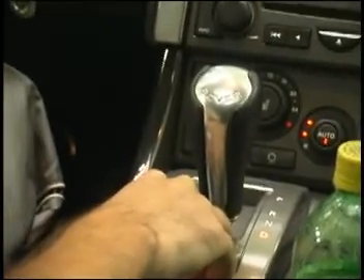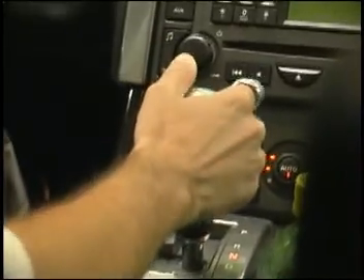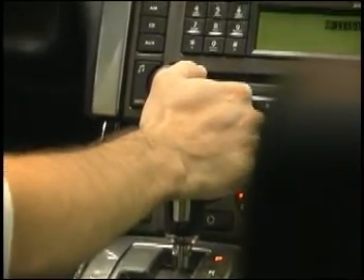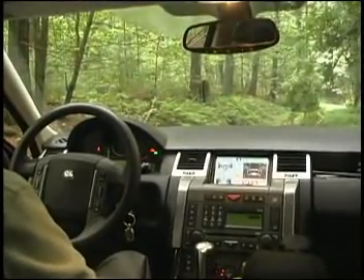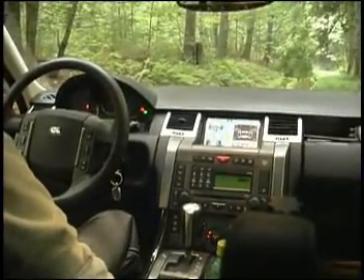Apply the parking brake, then transmission to neutral. Gently release the foot brake. Then back on the foot brake, and then into park. What this does is put the weight of the vehicle on the parking brake and not the parking pin in the transmission. When you put it directly into park, that pin gets slammed into the transmission and the weight of the vehicle sits on that pin rather than the brake. We refer to this as mechanical sympathy — getting the best performance out of the vehicle while being easy on it.